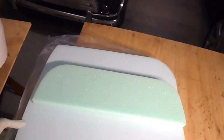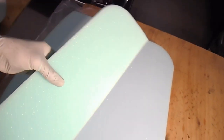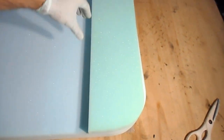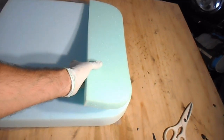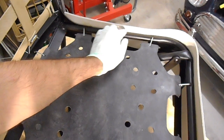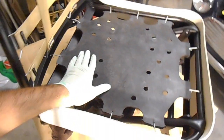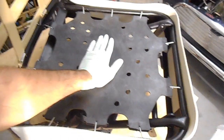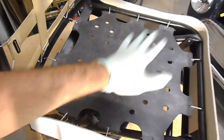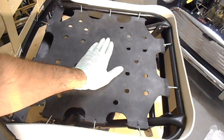The next thing we're going to do now is the foam base. Depending on the style of seat you have, you may need to glue the extra piece on first. If the vinyl has one section and then the stripes begin there - it depends on what seat. For the one I've got, I'm not going to use that bit. What I want to do is glue this foam - it's got to be glued to the edge on the inside here, around the edge, and also a bit onto here too. Don't cover the entire thing with glue, just a few bits in the middle, so the foam sits and gets stuck - just so it sits on there, because if you don't do that it sort of leaves a bit of a gap.